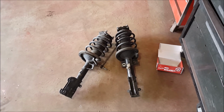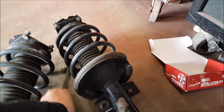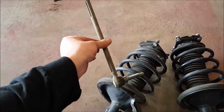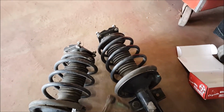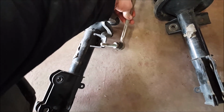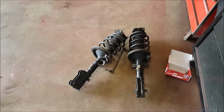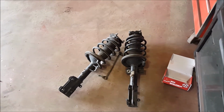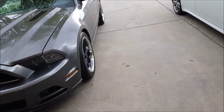The locations for these uber long stabilizer bar ends, I guess, I don't know what those are called, but anyway, they just go in the back of here and then go up to a stabilizer bar. With lowering the car, it actually has an adjustable one of those. So what we did was we measured those. I think those measured out to be like 24 inches. And we just lowered them 3 inches, 3 inches on every corner.